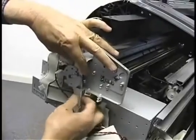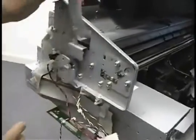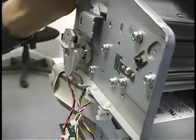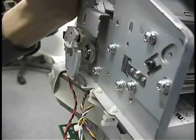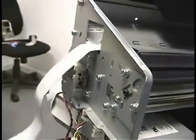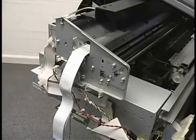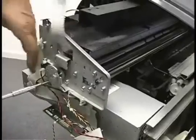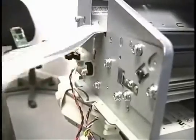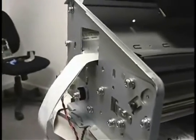Now we can lift the trailing cable up through this slot, and we need to do this so that we can access T8 screws that are back inside here that are attached to the paper bale internally. This is where we need the other extended T8 to go in and undo that. There's 2 screws. There's only one in there because I didn't put the other one in a while ago. So we'll switch back to the extended T8. Take that off of there. And there again, the standard T8 is way too short to get in and get that.